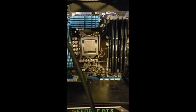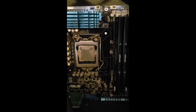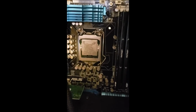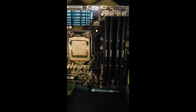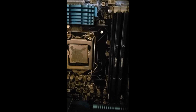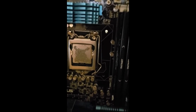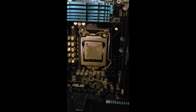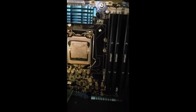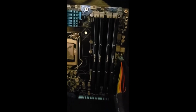The problem with the system is that it originally had the stock Intel CPU heatsink in it, and the system has started shutting down randomly due to excessive heat. The first thing I tried was scrubbing off the Arctic Silver or thermal compound components from the processor and the heatsink, and replacing it. But that didn't help all that much. So I suspect something is maybe cracked with the heatsink itself, so it's not able to remove the heat fast enough for the system to run stably.